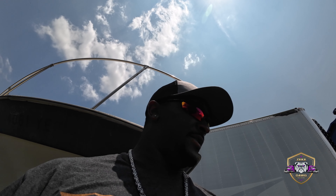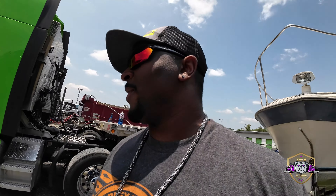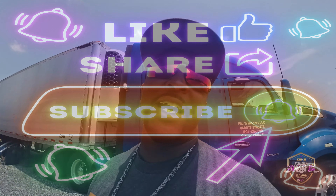We're gonna skip that. I got my aluminum wheel cleaner, my White Diamond metal polish, my Mother's polish, and a degreaser. My plan is to hit it with the degreaser first — it's a water-based safe degreaser — then with the cleaner, then Mother's, then White Diamond. I got water on hand since there's no water out here, and we're just gonna see how this goes.